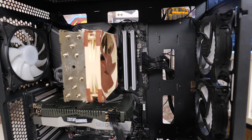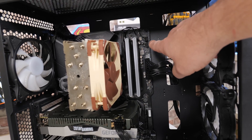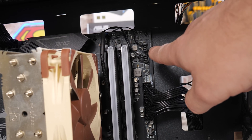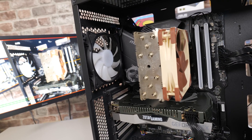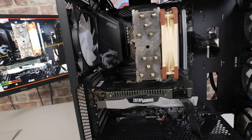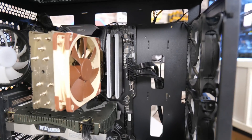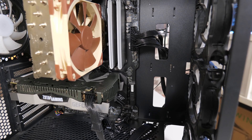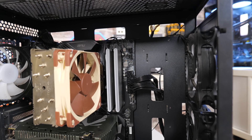This is the inside of my PC. We're going to point out why the wiring at the moment is a little bit more messy than it could be. As you can see in this top corner, there are two fans being plugged in — these are three-pin coming from the fans mounted up front. We've got three fans in the front, and there's also a single fan in the rear. The single fan I've actually wired up to a fan header on the motherboard, which is tucked away right in there. If I zoom in at the bottom, you can probably just about see there is another fan tucked in down there. Basically we've got the three fans plugged in into individual headers. I'm lucky on this particular board — this is the MSI B550 Gaming Plus Wi-Fi — it's got loads of fan headers, but if you've only got maybe one or two, this little device is going to come in extremely handy.